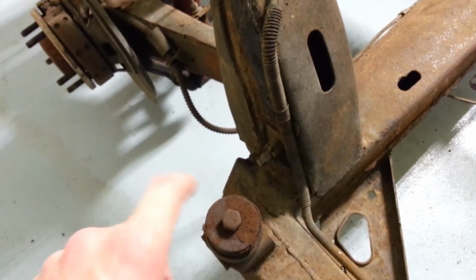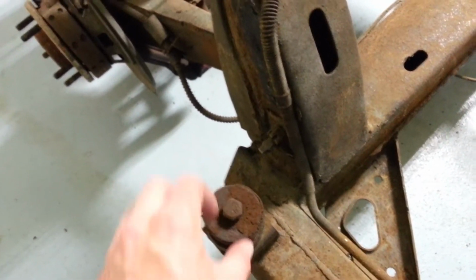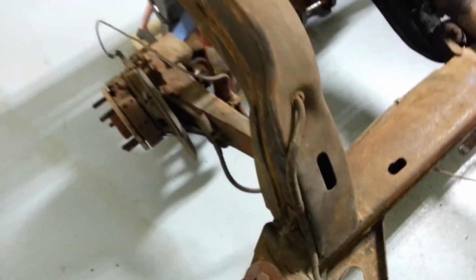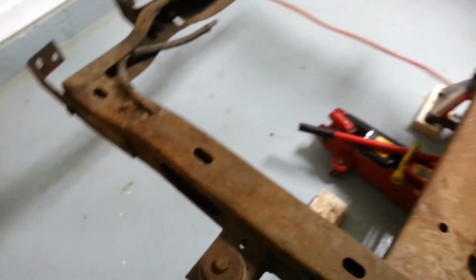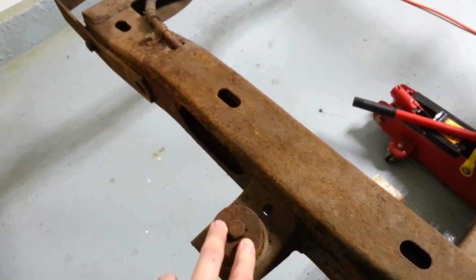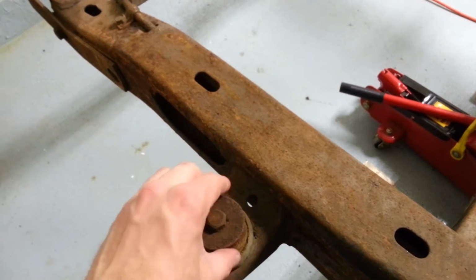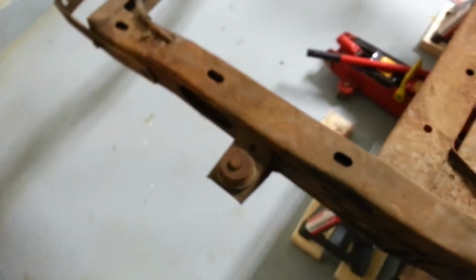There's a small panel with four, I think they're 5/16 bolts in there. Just take those bolts off, pull the panel off, and you'll see that bolt there. And the rear bolt is on the inside of the car, the nut plate side is, anyways. And the bolt is on the outside. You can see it back there in the rear wheel well area.